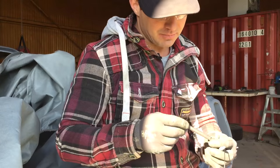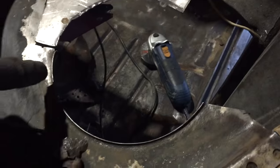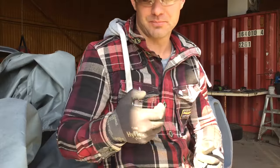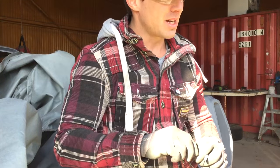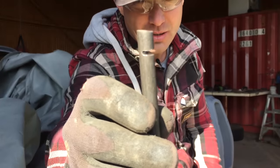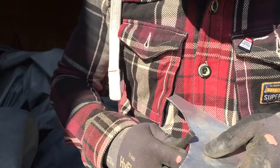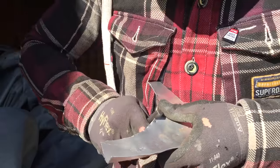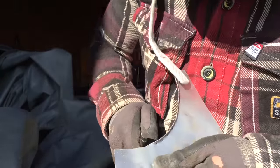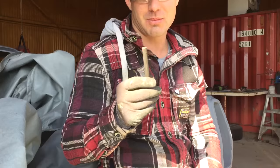One of the comments I got on YouTube when I was fixing that panel for the heater duct - it had a little gutter or lip on it, which is quite hard in a circular pattern to get up with a pair of pliers. Someone commented that if you grind a little notch into a bolt, you can use that as a lever to the height of where you'd want the lip to be, to then lever up the sheet metal and create that lip a lot easier than using the pliers. So instead of a bolt, I just used a piece of steel rod, notched it to the distance and height that I want that gutter, and now I'll just lever it up to create that little lip. Thanks for the tip.